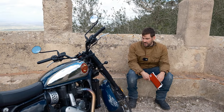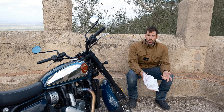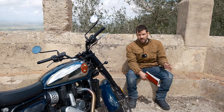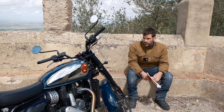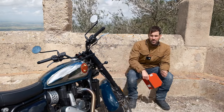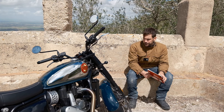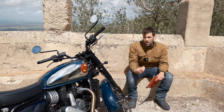I'm going to be completely honest about reliability. When the bikes were first launched in March 2023, there were a number of problems that early adopters experienced. The principal one that concerned the most people was engine stalling — if you'd taken the bike out for a spirited blast and pulled up at stationary traffic or a junction, the engine would cut out. It was to do with the fuel map; these Euro 5 bikes run really lean, with a super hot and lean fuel mix. There is an update to the ECU that was supposed to cure that, and I think in most cases it did.